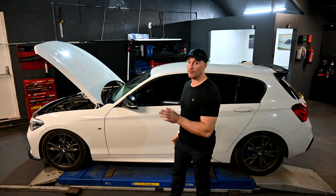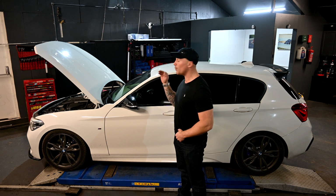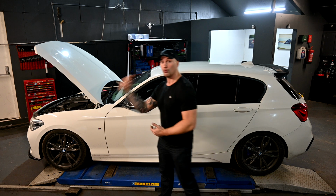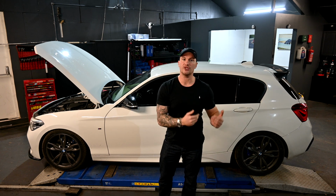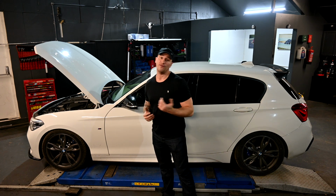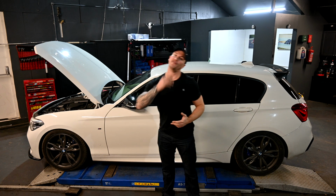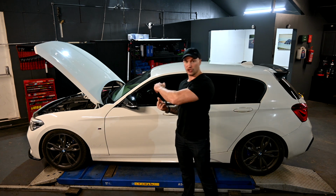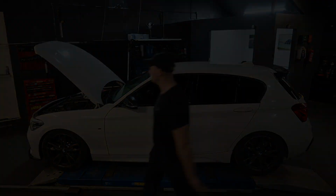There is another step on tuning these that is usually called stage 2 plus. That means switching over the fuel pump. So you use the newer 350 bar pump, or you might use a Dorch pump, but basically you're using a better fuel pump because the standard one crashes when you try to run too much power. If you do that, the last one we did we took to 488, and some cars are even seeing 500 brake with that fuel pump changed over. So that's the 3 most common stages of tuning on these. Stage 1, stage 2, stage 2 plus.